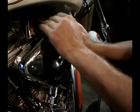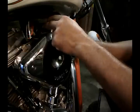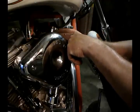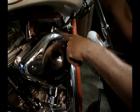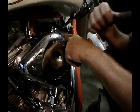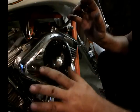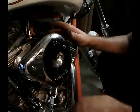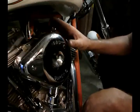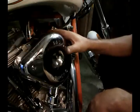When the bike runs smoothest — kind of the fastest — you turn it slowly one way and the other and just by ear find your sweetest spot. When you've got that, start opening the acceleration pump. I would start at probably two turns, then turn the throttle quick — you don't want any bucking. If it bucks and doesn't rev up right away, open it some more. Also watch your exhaust; you don't want a bunch of black smoke coming out. A neighborhood of two to two-and-a-half turns is usually good on the accelerator pump. I hope this video helped you — thanks for watching, and please subscribe. I'm going to have videos for a bunch of different brands, bikes, tips, and repairs.